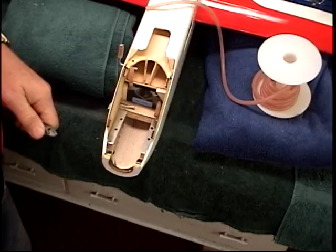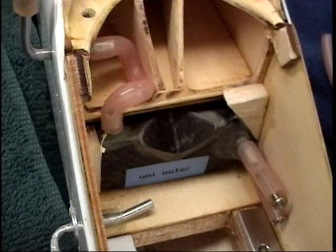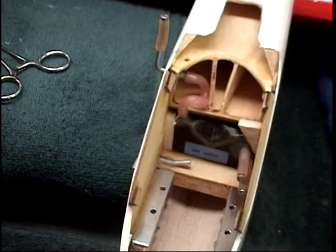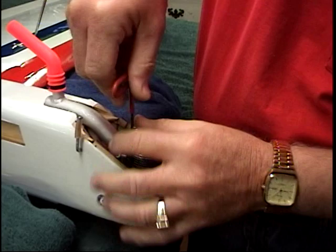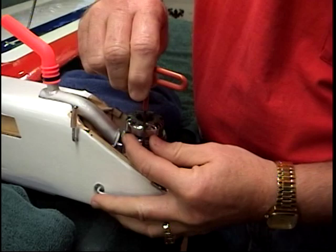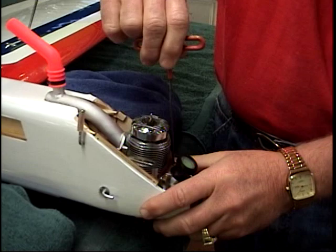Just a close-up of how I wound up using the venting for this — this is for a Road Jet — and this tank has a little detent for some of the headers and tuned pipes that I've used that tank on already. Now after the motor's installed, I want to get the tubing going to the engine. Make sure all the bolts are tight. I always like to bench run an engine a few times — or minimum once on the ground — and then re-tighten all the bolts. That's a good safety tip, no matter what size motor or what brand you use.